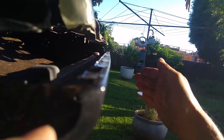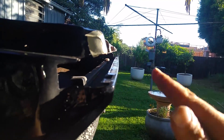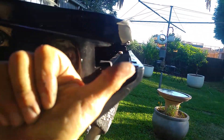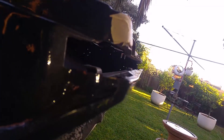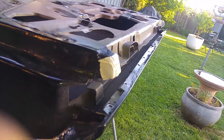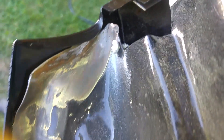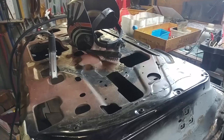That curve is just this reproduction skin — it's not in anything else. I might be able to stretch out these corners so the frame can go further into the skin. It's a little better but it's got a bit of an elbow there. Clamping and welding will be the best way to take that out. This corner is concerning — it'll probably need to be cut off.